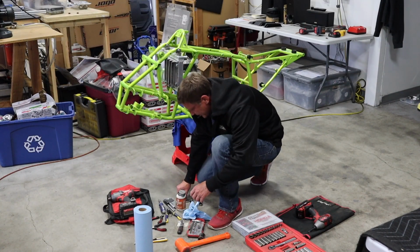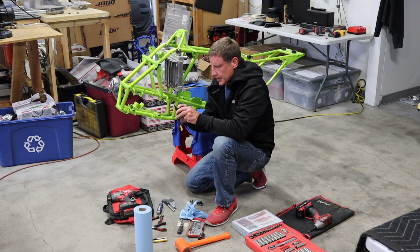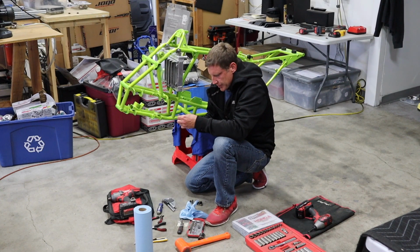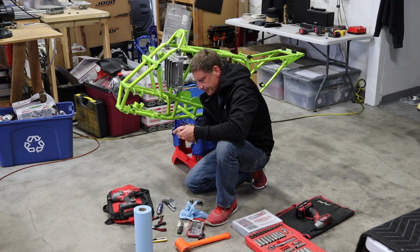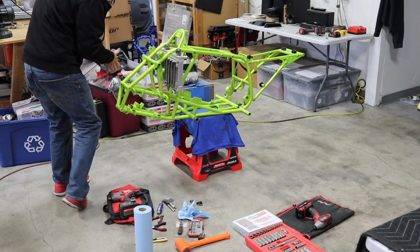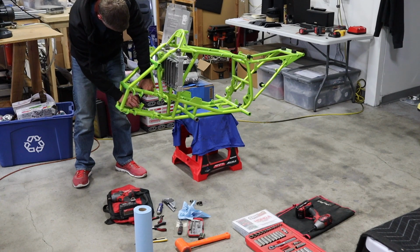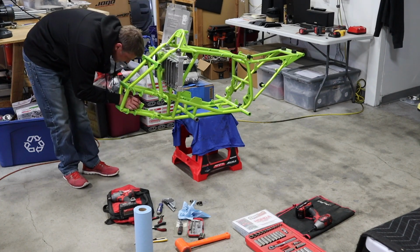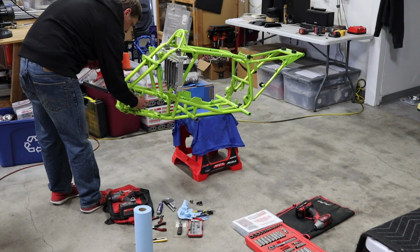So we're in there. Now we can take our C-clip, and this one we need to squeeze in. These are set up to squeeze out. So I'm going to flip these clamps. What's nice about this reversible one, I think I just got this at Lowe's or Home Depot, Vice Grip brand. The only thing I don't like about this one is the reach. When I'm doing the carrier, it doesn't quite pull it far enough. Seated, and then after it's in there, I usually just take that socket again and give it a light tap to make sure it's fully seated.